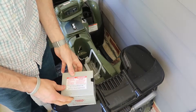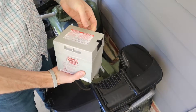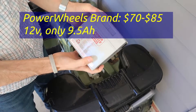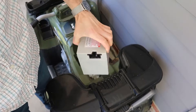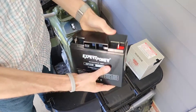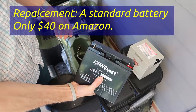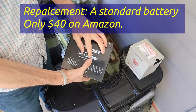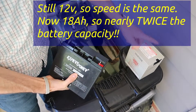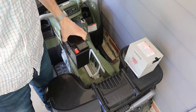This is the Power Wheels gray-top battery. A new one is about $70 to $80 on Amazon, and it's only 9.5 amp hours. When I pick it up I can tell it's a little too light for its size, so I know it's mostly empty. What I did was buy a 12-volt 18 amp hour battery — still 12 volts so it runs at the same speed, but the higher amp hour capacity means it should drive for twice as long as the original. It's significantly heavier too.